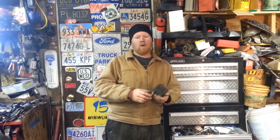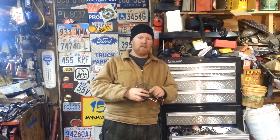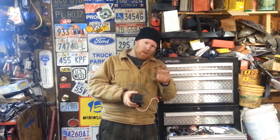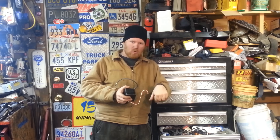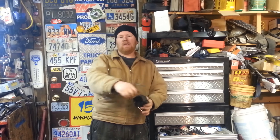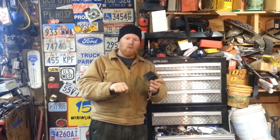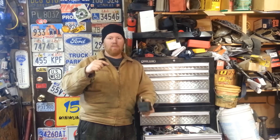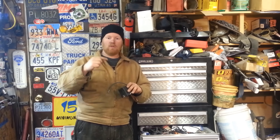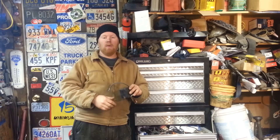If you're having trouble with yours, hopefully this helped you. Another common problem is the air pump at the back actually breaking the little vanes inside, and that not pushing any air through and being able to squirt fuel into the intake. You can see that by taking that off — if you see nothing coming out of that nozzle when you plug it in, there's a good chance your air pump is broken. But usually it's spark, air — just like a small engine. Make sure you've got spark, make sure you've got fuel. You can clear a clogged fuel line by taking compressed air and just blowing down through it — if there's any debris it'll blow it out and then you can re-suck it up.